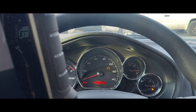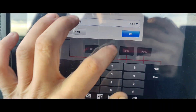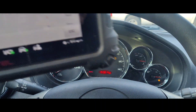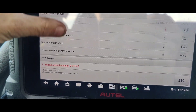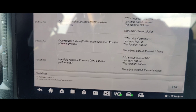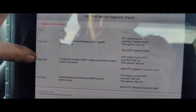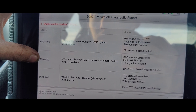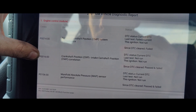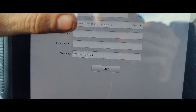See if we can type our odometer in — 155,814. That's what I said. Camshaft intake correlation code. That's not good. We got a correlation code. I'm going to say that we need timing chains.